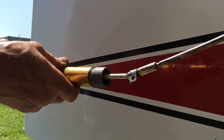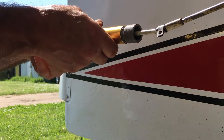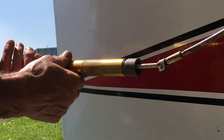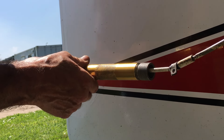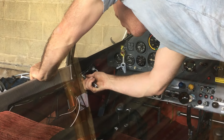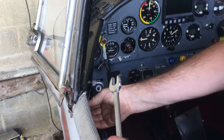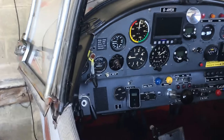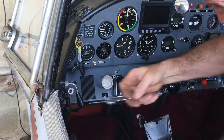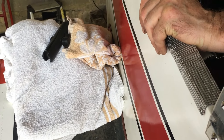That's all now secure. Hopefully it goes in far enough. We'll see how much we've got, then use the plunger here to wind it in and force oil up the cable. I think we've got enough — it's not going to go the full stroke. It's a little tight in this restricted space. This clamps the cable to the control, and this is where the oil will spill out. I've got the towels and bits and pieces ready.